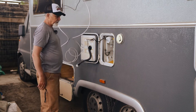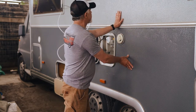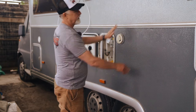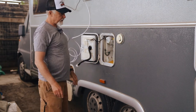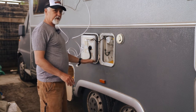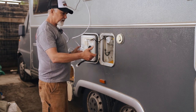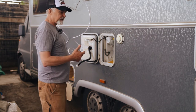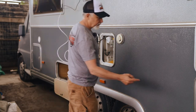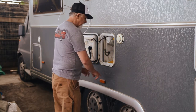It's going to have to be screwed in here and here, and that'll do the job. This back section is the worst — you can hear it moving and closing up the gap as I push it. So I'm going to drop a plank down there, screw it in, measure everything twice or three times, get the bar in place, probably hold it with clamps while we double and triple check, then drill big holes through here, through here, and at least one through here, probably two.